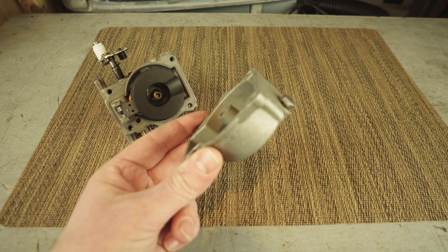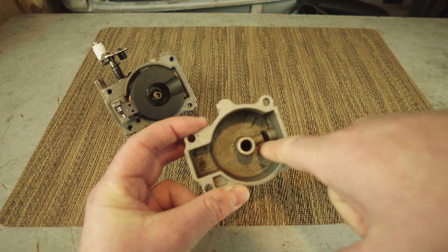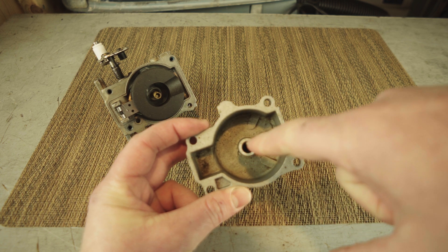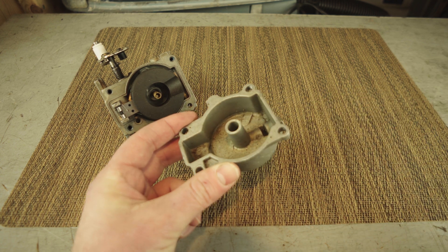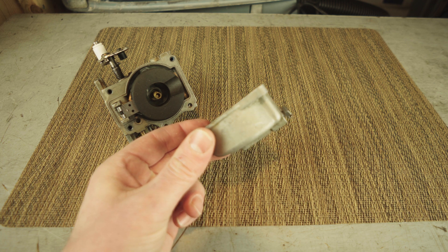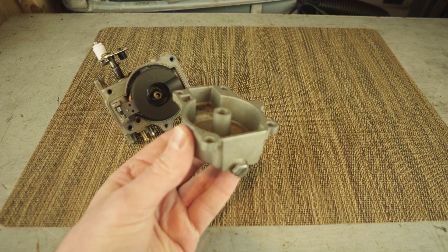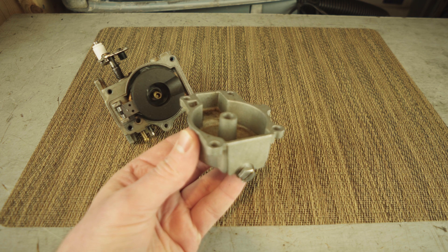For a while I just couldn't figure out what was happening out on the water. It actually turned out that the fuel valve inside this hole was completely blocked and the engine was running on one cylinder. This is why it would only run with the throttle advanced at full speed — it just gave it enough juice to turn over and run.